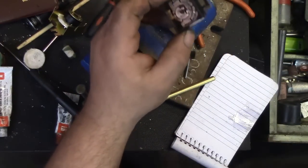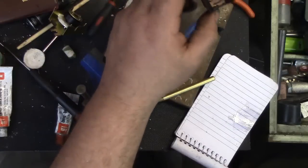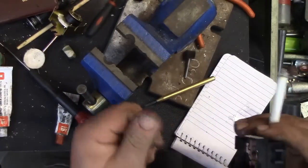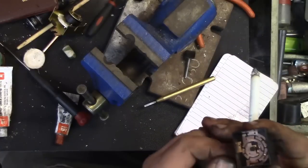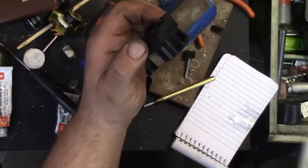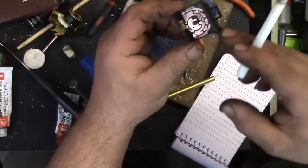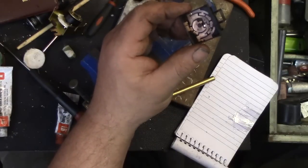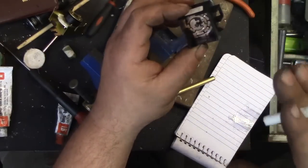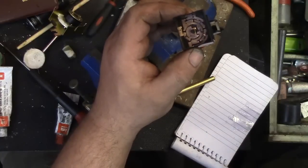Here's another little tip for you. If all you have is a wire brush or sandpaper to clean up a contact on a switch or a wiring post, before applying power to it, work it. Work your switch, work whatever physical connection a bunch of times to wear down the high spots created by the brush or the sandpaper. Because if you have juice going to it and you start sliding your contacts around, you're going to be burning off the very tops of those crests and the grooves that get left in place on the metal. So it's better to have the power off and mush them down and burnish them into place and increase the contact area before putting the power to it.